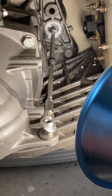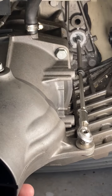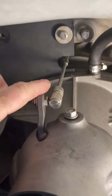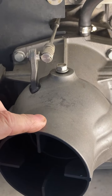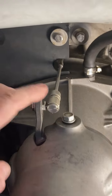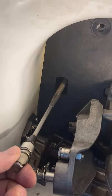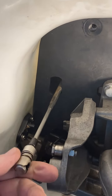I want to call them push rods, but they call them cables. This is the steering right here — I just replaced this one. This other one is the tilt; it tilts the nozzle, and it is stuck — frozen, not moving. This one is working.